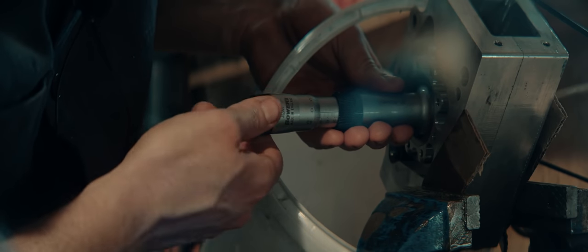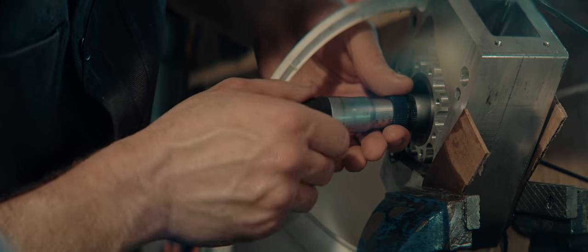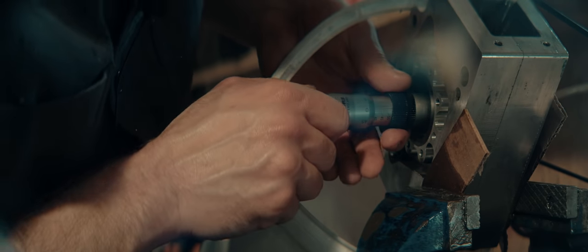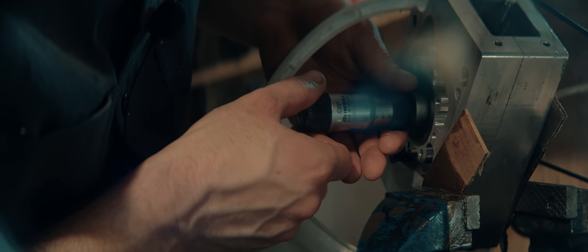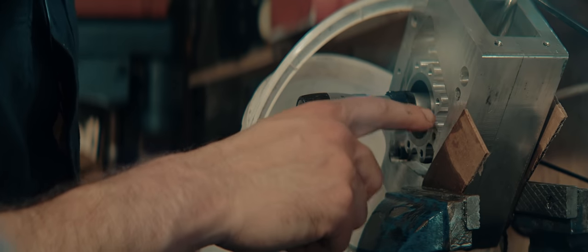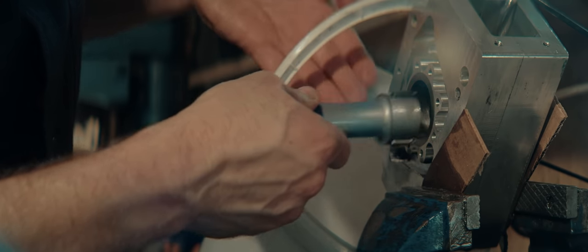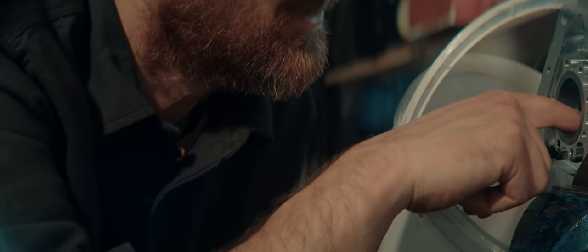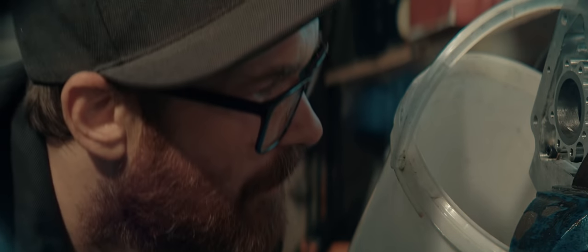Pretty much on size. We're like 2/1000ths of a millimeter over. That's within tolerances, I'd say. Maybe 5/1000ths of a millimeter over at the bottom: 40.005 and 40.002 millimeters. That's spot on. That's all I have time for today. Tomorrow we'll chamfer the port edges and relieve the exhaust bridge, and it's time for assembly and startup again.